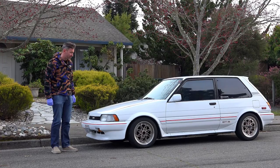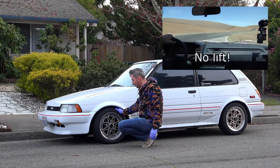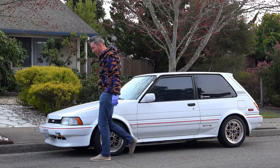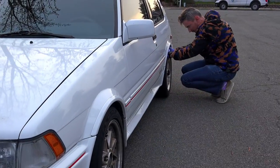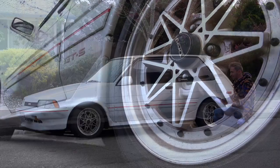The drive went really well, but guess what broke — it wasn't the cooling system. It was something kind of unexpected: the front wheel hub bearing. I don't know if you remember in my last track day video it was giving me some trouble, well now it's totally broken and it's making some nasty noises. The driver's side is wrecked; the passenger side wheel hub is still okay. I also checked the rear wheel hubs and found that the driver's side rear one also has some wiggle and play to it — it's on its way out as well.